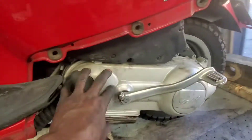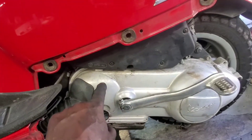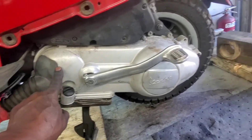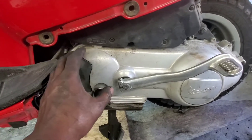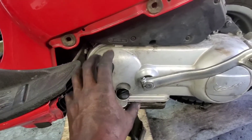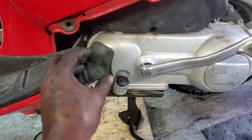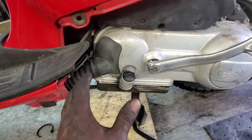Going through the transmission on the bike: the belt is good, the clutch is good, the front variator is good but it was absolutely filthy. There was rust on the front spline and the backing plate was actually stuck to the back of the engine. This is primarily where it should reside, but there should be movement and play. It shouldn't actually be rigidly stuck on the spline there. The plate has teeth that align with that spline and they are, for the most part, completely worn off.